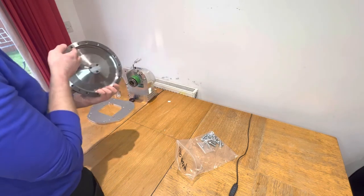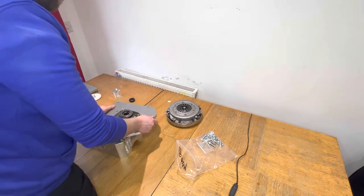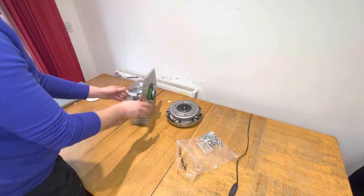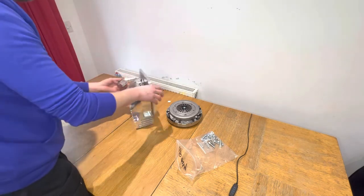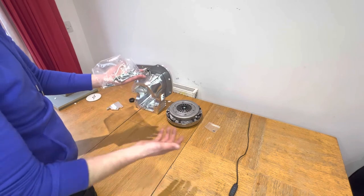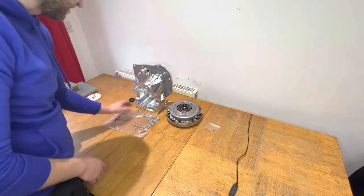The kit does not come with a friction plate, so you will need to supply your own. That's what it should look like assembled in the car, and your starter motor bracket will be on this side. All the nuts and bolts in the kit are supplied. When you come to bolt the flywheel to the BMW flywheel, you will need to use the existing flywheel bolts because they're a funny size — about M7 or something like that.